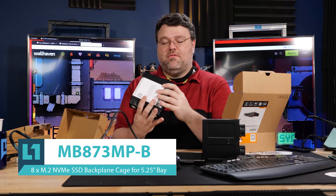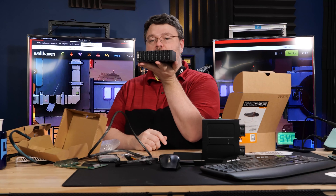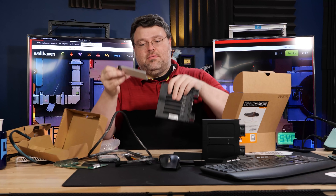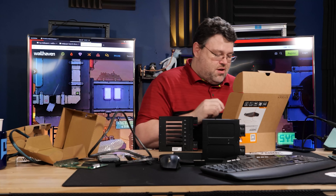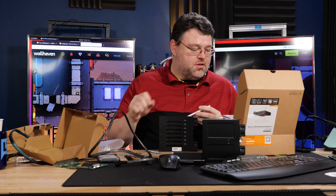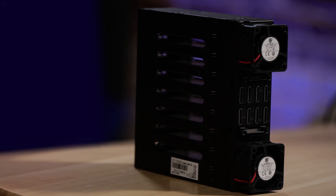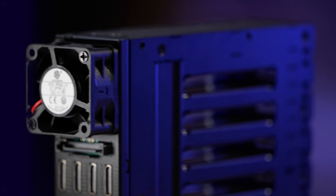This uses the same type of cables as the PCI Express 4 U.2 version, but instead of being 4 U.2, it's 8 NVMe. And it supports 110mm M.2 — fits like a glove. It comes with thermal pads and everything you need to mount drives. You can get 8 two-terabyte NVMe drives in here for 16 terabytes of flash storage, and you can RAID it however you want: Linux LVM, RAID 5, RAID 10, RAID 6, whatever configuration you want. It has 8 SFF connectors on the back.